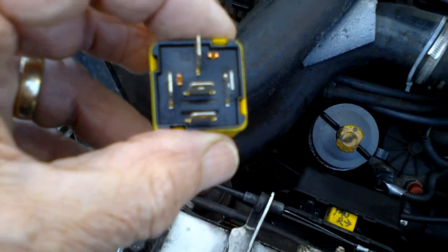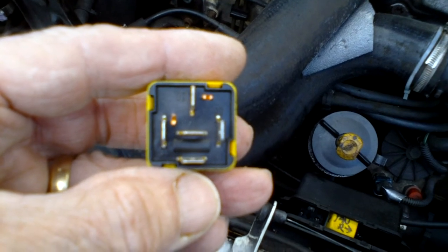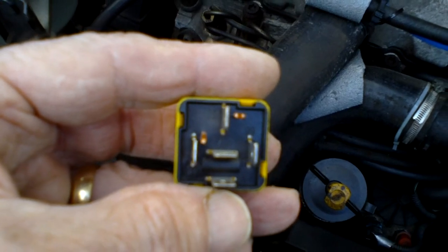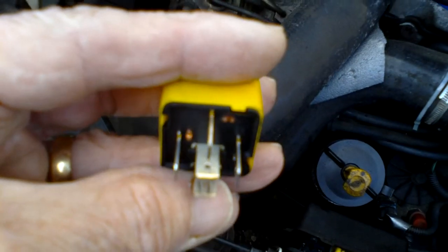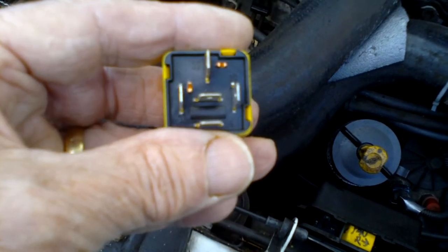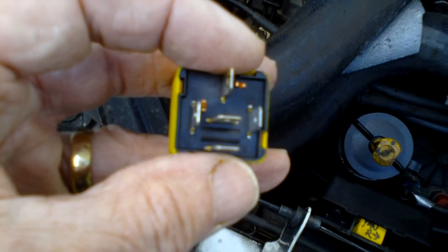These relays are quite simple - you've got two pins which are for the relay coil and two pins which are for the fan, passing the heavy current. The relay coil works in connection with the temperature switch, which earths out to the bodywork, energises the relay, closes the contacts, and that then allows the fan to fire up. Nice and simple - but which ones are which? Let's have a look and see what's going on. We've got five pins - one's just a locating pin so you can't get them the wrong way round - and all you've got to do is check with a multimeter.